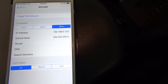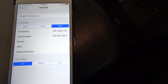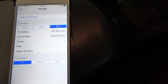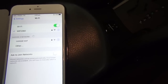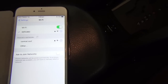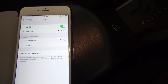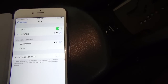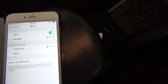Don't put any other parameters in — that will allow you to also use your phone to connect to the internet or send texts or whatever while doing this, as the interface won't be set up as your internet interface. The password for this, I worked out, is 12345678. That'll hook up the Wi-Fi. Once you've got the tick on the Wi-Fi OBD, just minimise that.